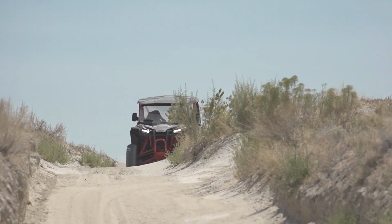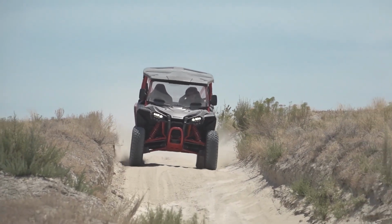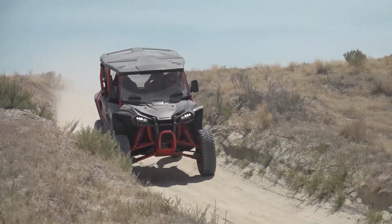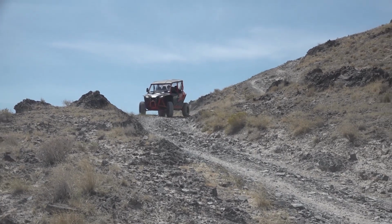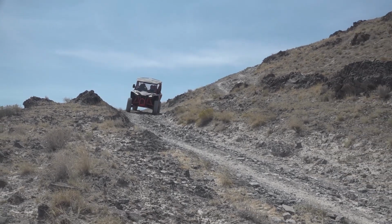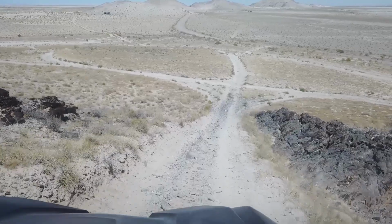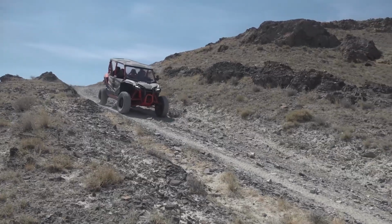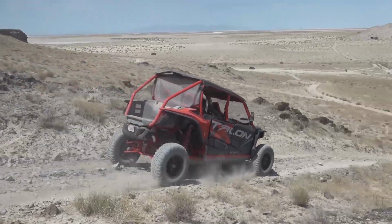But once you get up there and it starts shifting its way through the gears, you all of a sudden realize that your engine is responsive to you. And you don't have to have any gimmicks like a hill holder to bring you down the hill. If you need to clutch back, you've got gears engaged and you can use engine compression just like any other vehicle. And so it really makes the sure-footedness coming down steep grades really, really comfortable.